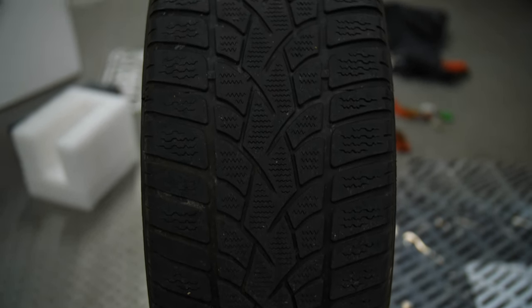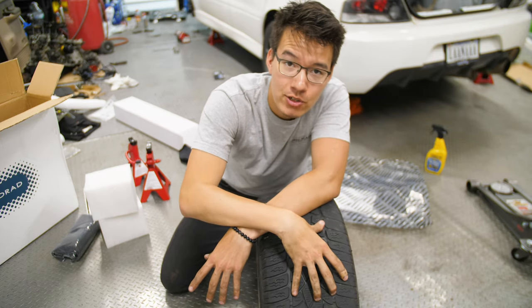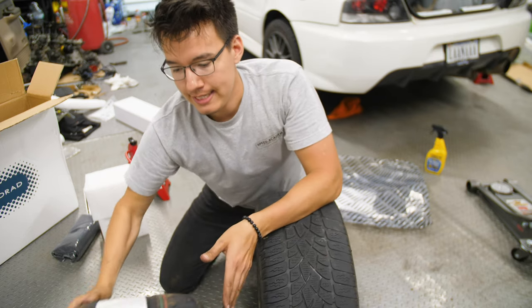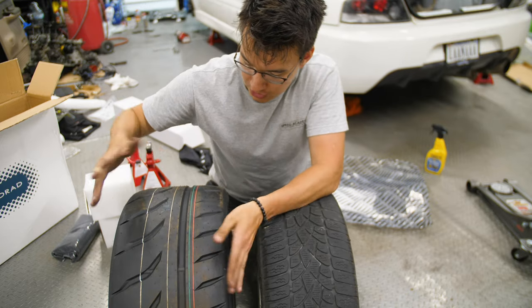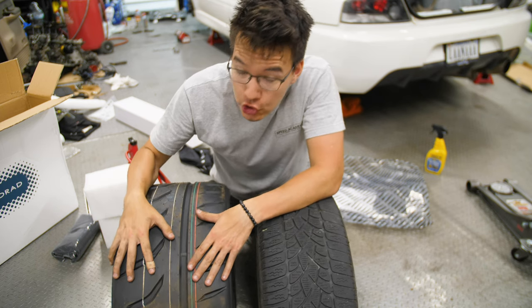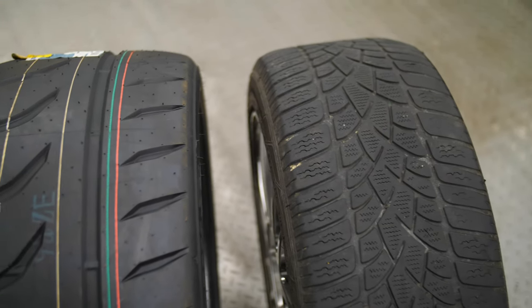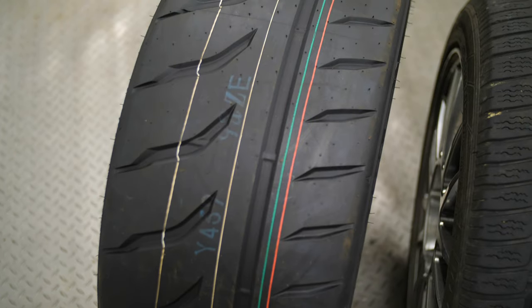Right, so for example, this is my winter tire. This is the 235 section with all of these Hakkapeliitta sipes cut into the tread for maximum snow grip, and these would be a terrible idea on track. Meanwhile, we've got my buddy Mark's R888R from Toyo in a 275 section. This is some fresh meat. Some good rubber for the track. And these are 100 treadwear, way wider tire. Obviously, massive sections of tread. No siping for rain, really.